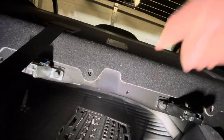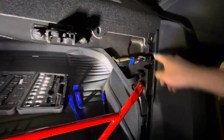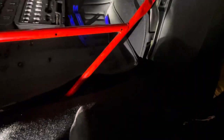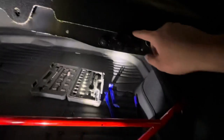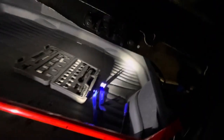Your dome light is not going to help you here - you need an actual light. Seven pop clips total, and you can't see much because it's too dark. Plus you've got the two screws on the sides. So after you take all of those out, what you're going to find is the trim is still stuck in there, which is kind of annoying.